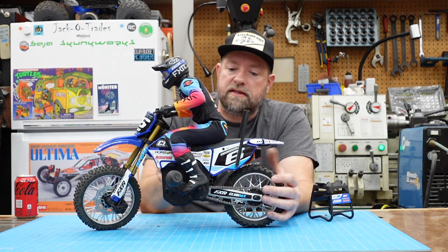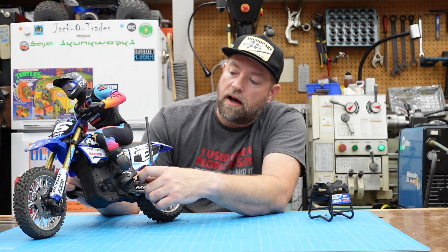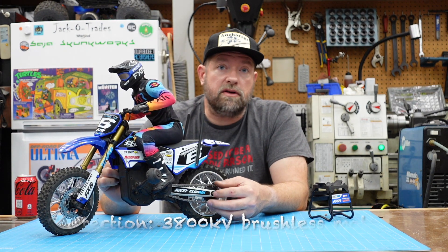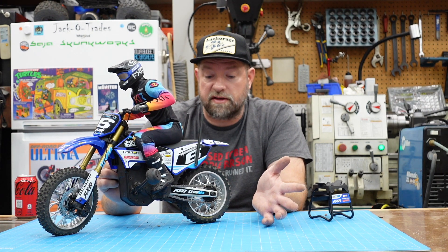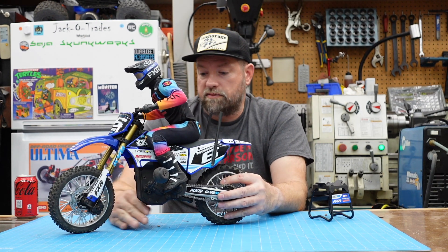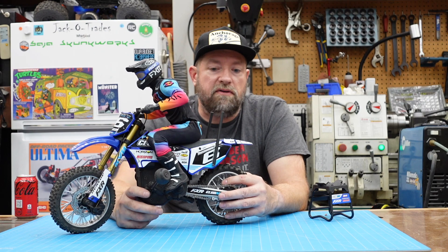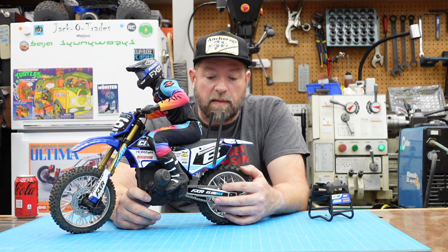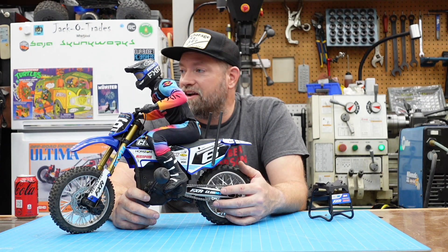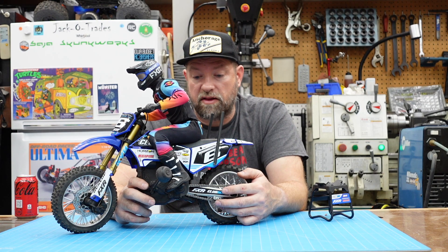The other thing you can do on this bike — I had the side panel off to look at the drive sprocket and there's a brushless motor in the drivetrain. It looks like a standard brushless motor, a 3700 kV motor. I thought you could probably replace that with something different, like a 4600 kV motor. You can probably put a faster motor in if you want to go that route, though it will likely result in shorter run times and the motor might overheat. I'm saying this without research — I haven't read the manual on motor changes — but that 3700 kV motor could potentially be swapped.